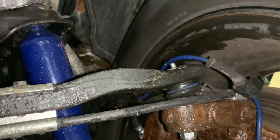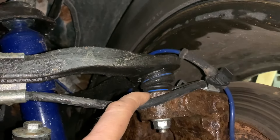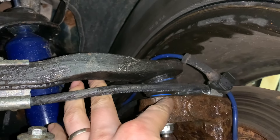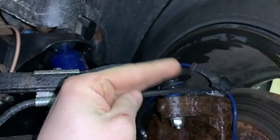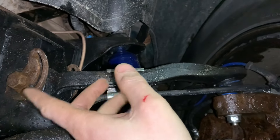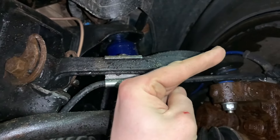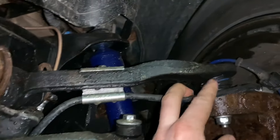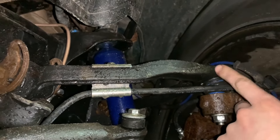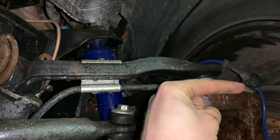Let's lay it down on the ground for a second. You can see the angle of the ball joint — look how much it's tipped up in comparison to the flat part of the knuckle. And that's only with the weight on the truck; the control arm hasn't dipped yet. When the frame goes down hitting a pothole or braking, the control arm rises relative to the frame so the upward angle is going to increase, putting a lot of strain on that ball joint and affecting the wheel alignment. I'm going to take this control arm, flip it over, take the ball joint out, and put it in the opposite direction so the angle here is more downward.